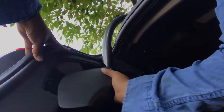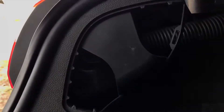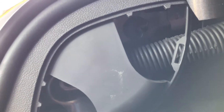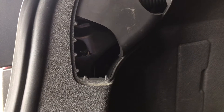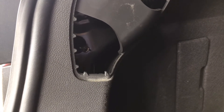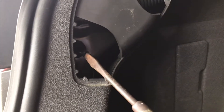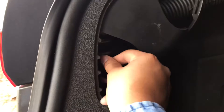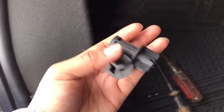Here I'm just going to show you the cover that we need to pop right off in order to get access to the bulbs. And it wasn't so hard — I just popped it off just like so. And then inside we're going to see the wing bolts that we need to take off. There's one right there, and then there's another one on top. I used a flat head — you can use pliers in order to take these off, but I only had a flat head. It was rusty, but it did the job. Lefty loosey, so it easily unscrewed. I go with my hand and unscrew it, and then boom it came off. I repeat the process for the one on top, and then these are the wing bolts that I ended up taking out — just set them aside.